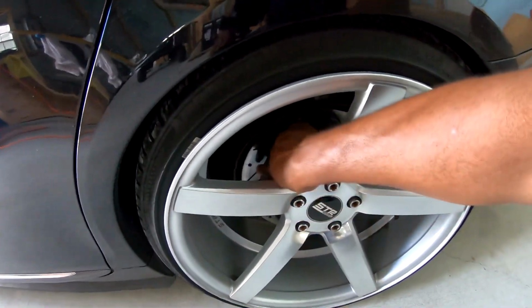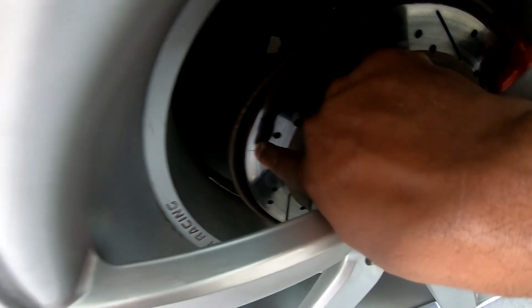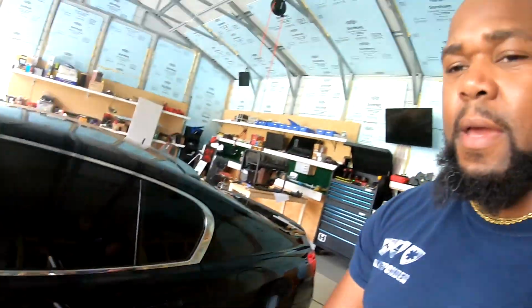I showed y'all. See how I got slight cracking? See, some of the holes got slight cracks, stress cracks. And I seen that on at least 3 of the rotors, maybe all 4. And so we got some new rotors here now. Hard rotors, non-sponsored of course, and the ceramic hard brake pads. And we gonna go ahead and get these things cracked open, man.